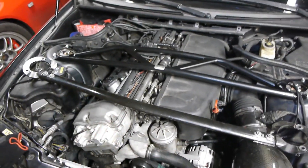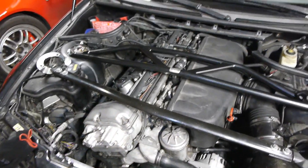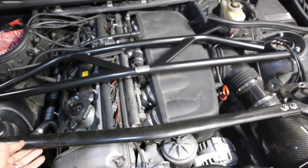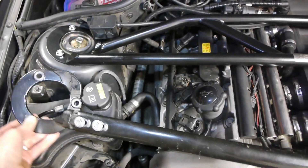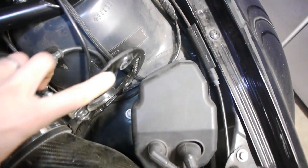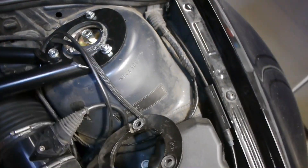Today let's talk about chassis rigidity. This is the stock bar that comes on the E46 M3 on the later years. It has an interesting design — you can actually slide it back and forth as you loosen it, so you can adjust it. It has these protrusions that pressure the shock tower, and a lot of people actually crack these at the ends on the track.